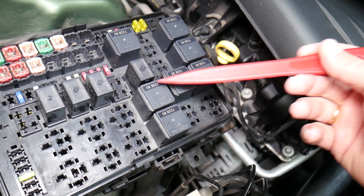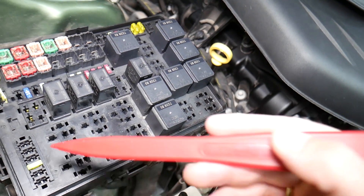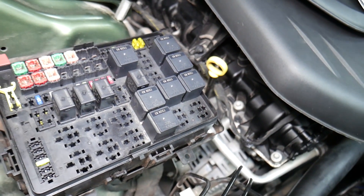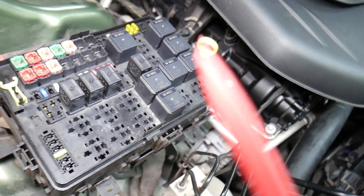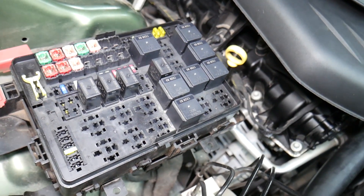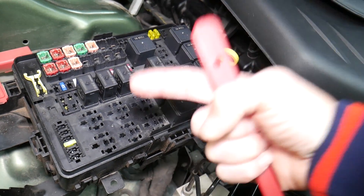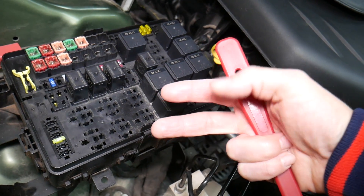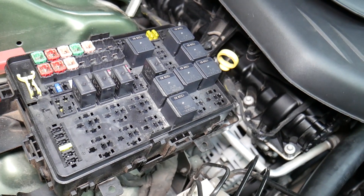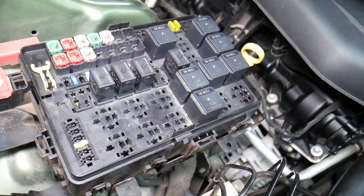The same thing for relays — some of those could be really expensive on cars. We'll put a link in the description below on how to test relays. For certain fuses, it's important to disconnect the car battery when removing them; otherwise you can burn the electronics. For instance, when working on airbag fuses or anything like that, you need to wait at least one hour after disconnecting the car battery. If you're not qualified and certified to work on the airbag system, I will never recommend you do that. Also, when disconnecting the car battery, it's important to know which battery terminal you disconnect and reconnect first — if you do it the wrong way, you can burn electronics modules. We actually burned a traction control module on a BMW that cost $2,000. We'll put a link in the description below on which battery terminal to disconnect first.